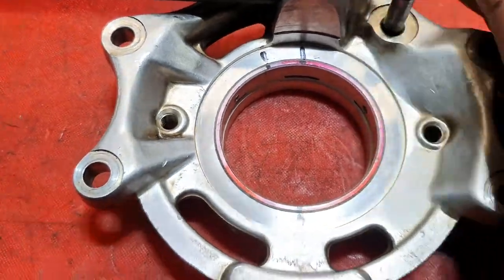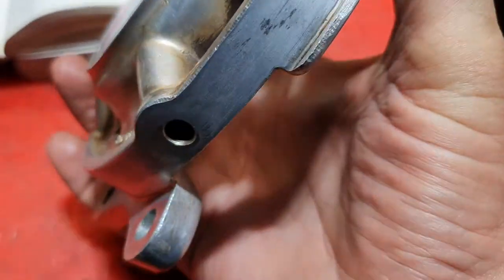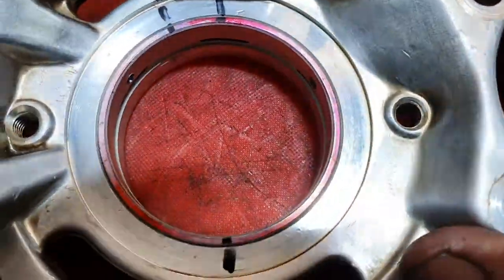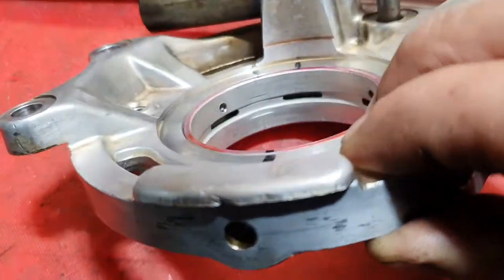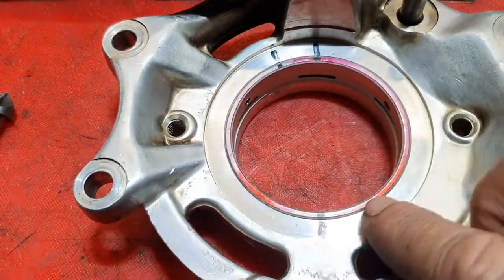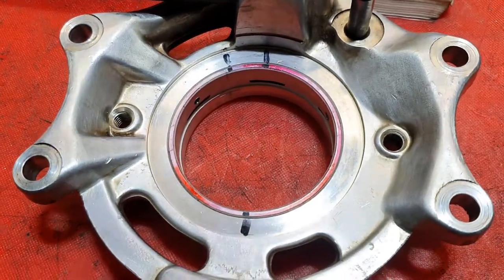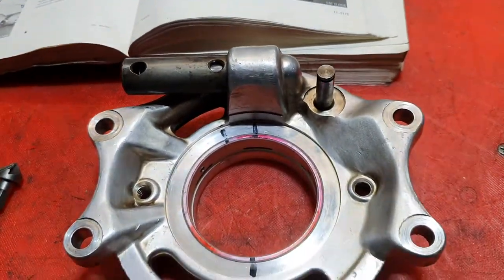In the back of this — this is the oil distribution center, as I've often called it — up the top here you can see through the main bearing there's a ring. If you look in the main bearing you can see there's a whole lot of slots in there. The oil comes out of the filter straight up into the bottom of this main bearing carrier through quite a large hole at high pressure, goes around the whole setup in a trough built into this, and flies out through these slots in the bearings to basically make the crankshaft float on oil.